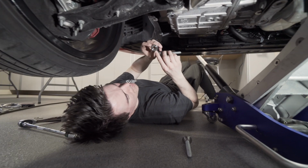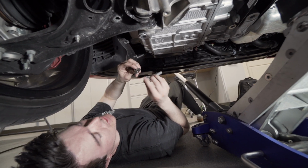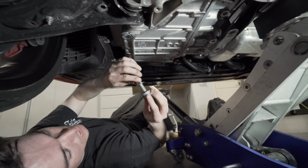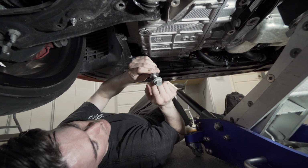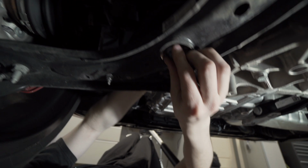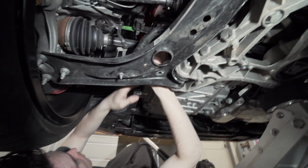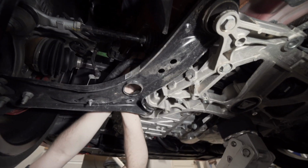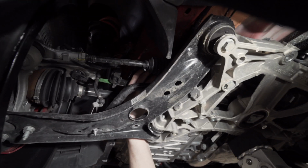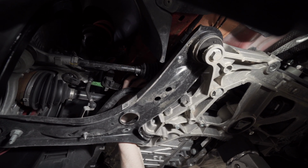So we have the 601-0027 collars. There's 4 of these in the kit. And then these are our new factory subframe bolts. So you just get it on there, make sure it's oriented this way so that the wider flange meets the washer on the included bolt. And then all we're doing is getting it back up into the front hole, making sure when you insert it that it doesn't upset the alignment of the top collar that we put in, and then you're gonna shift it so that you get it aligned correctly.